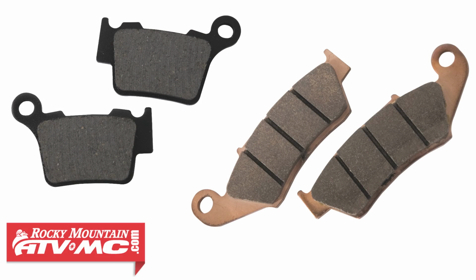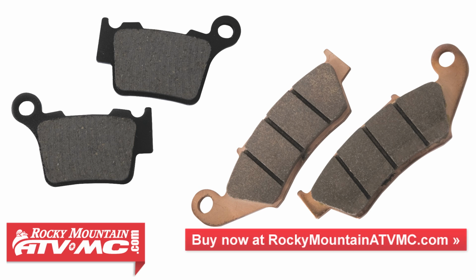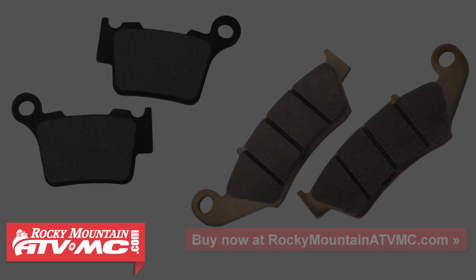It's always a good idea to replace your brake pads when installing a new rotor, because your old worn out brake pads will be worn down into the shape of the old rotor, and if you use these with your new rotor, you won't get full contact from the pads and your brake performance will suffer. So installing new pads is highly recommended.